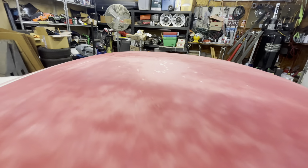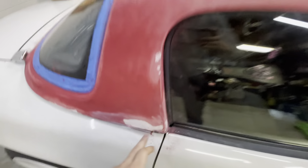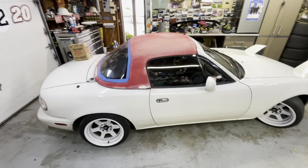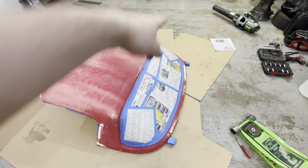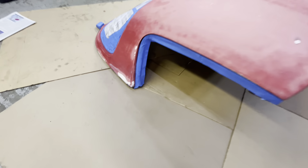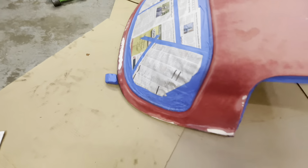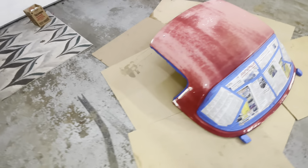Here's what we're working with right now. All this stuff is completely smooth. I did the whole roof in 600 grit and all these little spots in 320. All these spots are smooth now — yesterday they were really bad. Here it is fully covered — got the whole back window done, the clips, all the rubber seal on the front and sides. I did it double wide so I don't get any overspray, and I'm going to be holding a piece of cardboard when I do it.